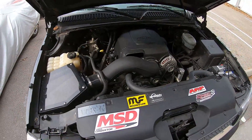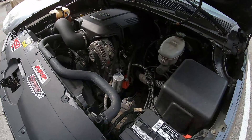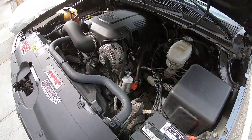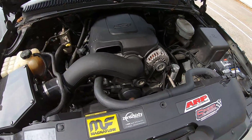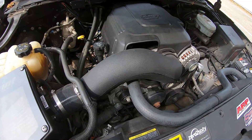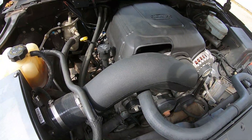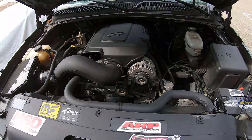This swap is pretty straightforward as it obviously came with a V8 in it, so it pretty much just drops in and everything changes over. We went ahead and did the LS3 Stage 2 NA cam from Texas Speed and got rid of the displacement on demand on this motor.